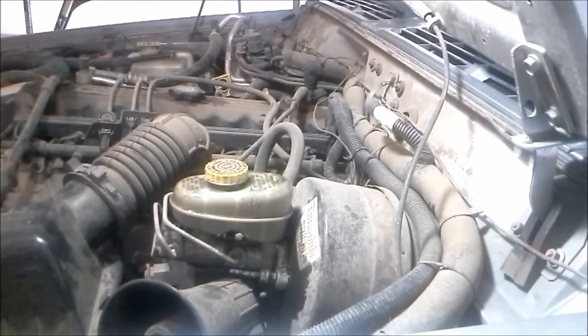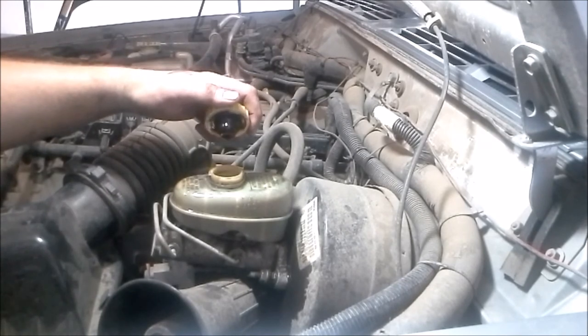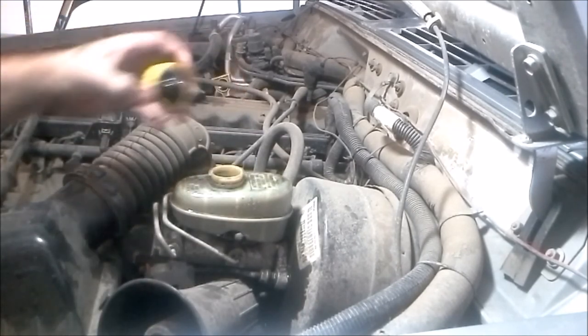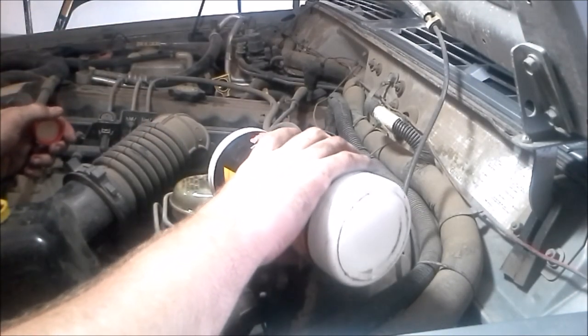As you can see, when I pump the brakes a couple of times you can see the brake pads moving closer to the caliper. The first time I pumped it, the pedal went all the way to the floor with almost no resistance. So it's very important that you do that — if you were driving and had to stop, that would be a very bad feeling. Make sure you pump your brakes a couple of times to firm them up. Now we can see the level has dropped a little bit, so I'll fill this up to make sure we are completely full. Just for reference, Jeep Cherokees take DOT 3 brake fluid.